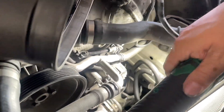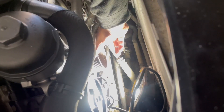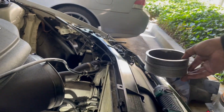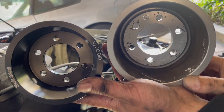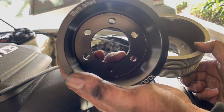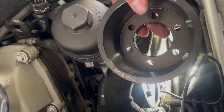I'm going to hold the pulley and tighten it. The next thing I need to take out is the crank pulley down here — there are six bolts and they're all T45s. Here's the stock crank pulley. The two crank pulleys side by side: the stock one is a lot bigger and the new one is a lot smaller, so this one will be spinning faster for more performance. Each bolt is going to be torqued to 20 foot-pounds of torque.